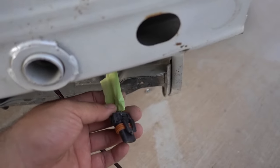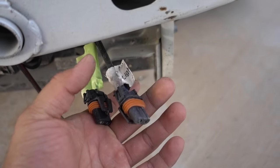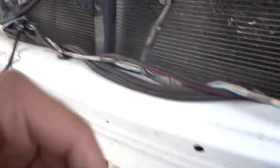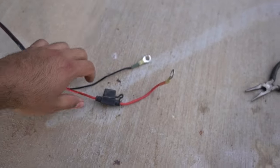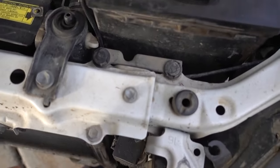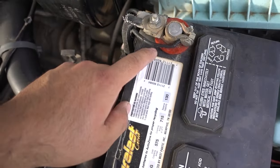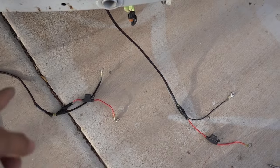Since I don't have any of these connectors lying around, I'm going to be using the same ones we used here — I have a lot of extra ones because of my fog lights. We're going to be snipping these off and putting the other type of connectors on. We don't need a fuse anymore because the relay already comes with a fuse pre-wired on it — you can see it right here — so I don't have to worry about the fuse anymore.